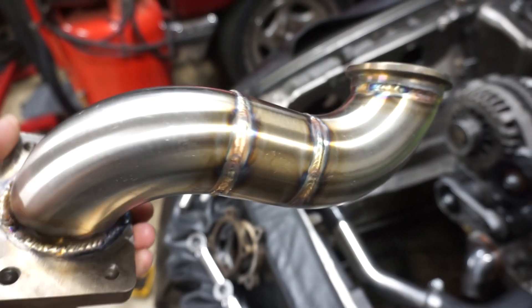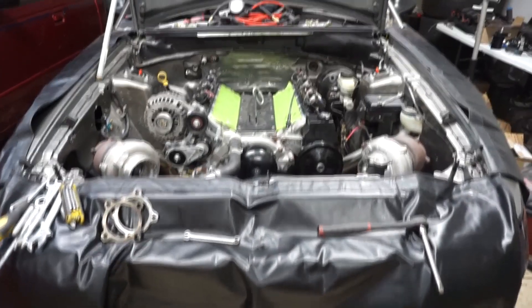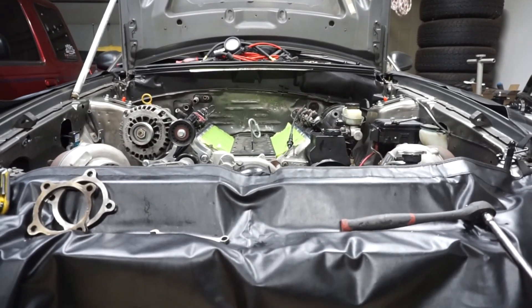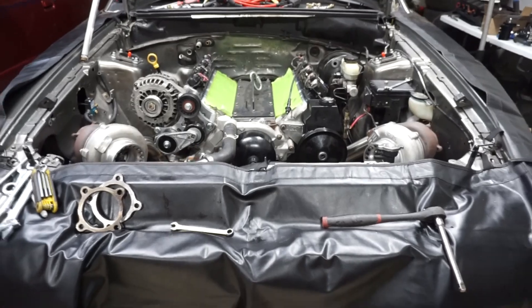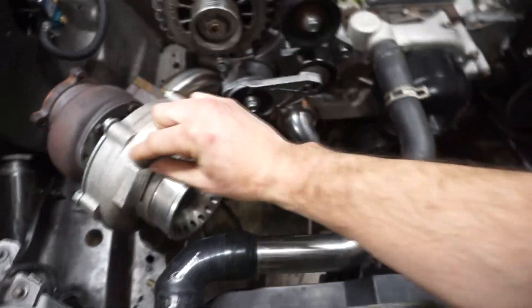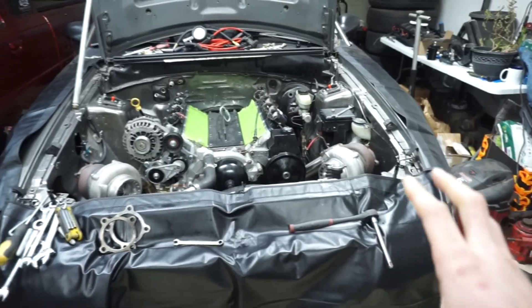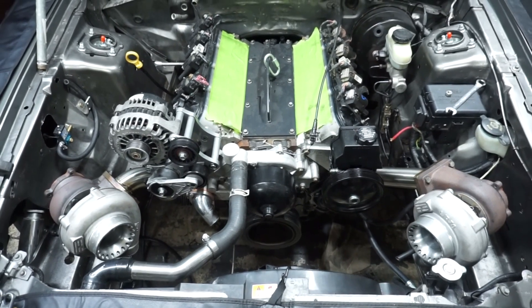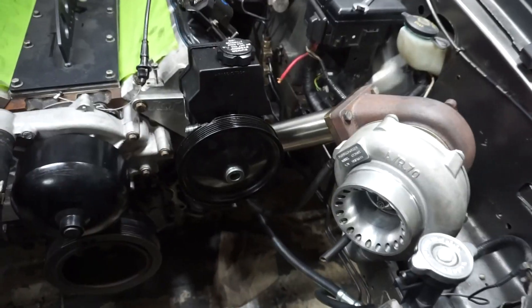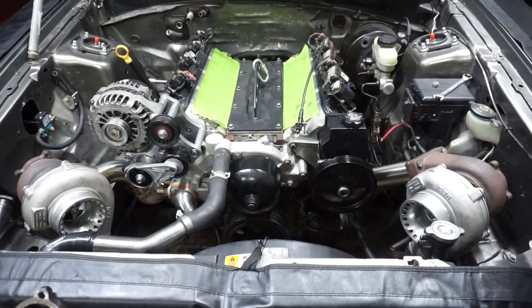Here's the plate with the turbo flange all welded up — this is for the passenger side, and it turned out pretty well. I'll bolt both turbos up and see what it looks like. If you look at the opening on the compressor, it's pretty much level — they're very close. There's a little discrepancy in the widening of the compressor housing, but they're pretty close to the same angle. There's a lot of other stuff in the engine bay that would distract from any little differences, so I'm pretty happy with how that turned out. Next video I'll be doing the wastegate placement — we should be able to get the wastegates nice and high up off the ground so you don't have to worry about bouncing them off anything anymore.